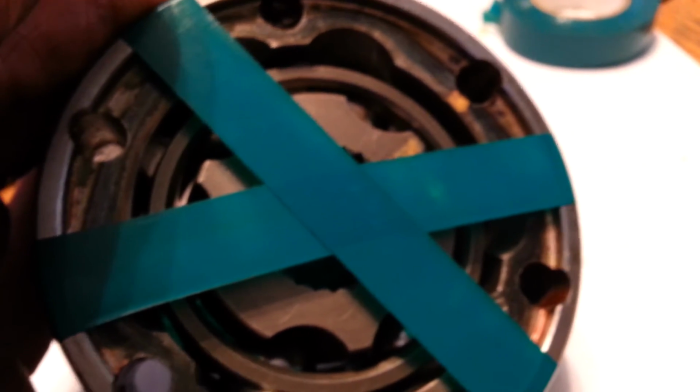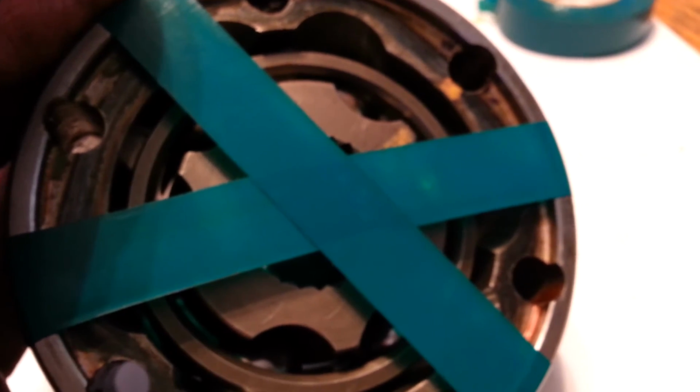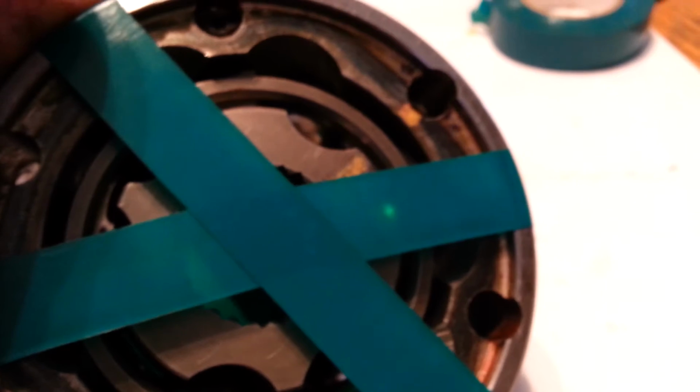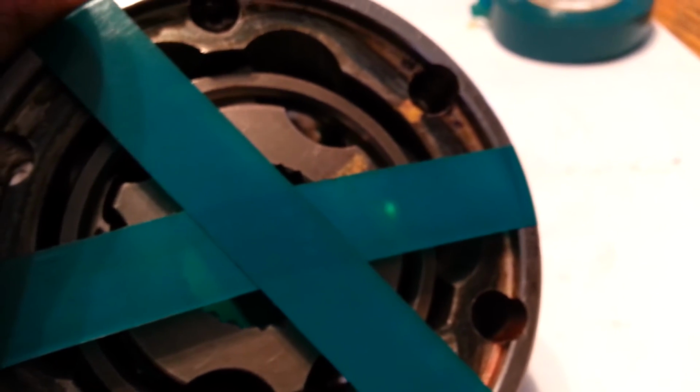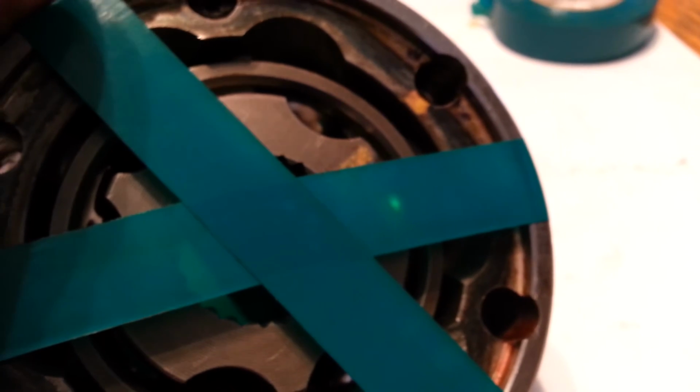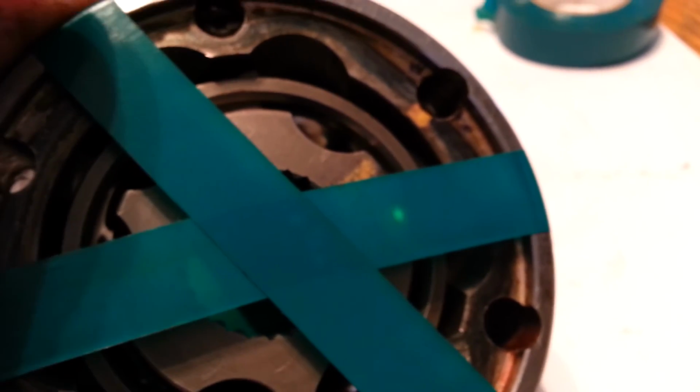And I had to look at other videos to see the lineup of something that was almost done. I guess these guys might have pulled it apart to do balls, because that's another thing to remember too: when you're looking at the different parts, if you're seeing any scarring or pitting on the balls themselves, you want to replace them. Might as well do that before you stick it all back together and have to replace them because they're binding. Because boy, these things bind anyways without grease on them, and I'm doing this dry, so those are the little things to keep in mind when you're busy doing this. But yeah, that's basically what it looks like when I'm done. Now to take it out and go reassemble it. That should be fun.